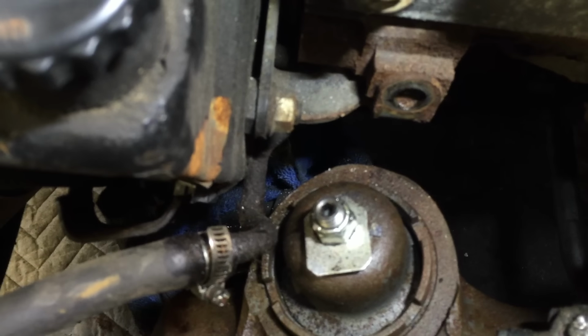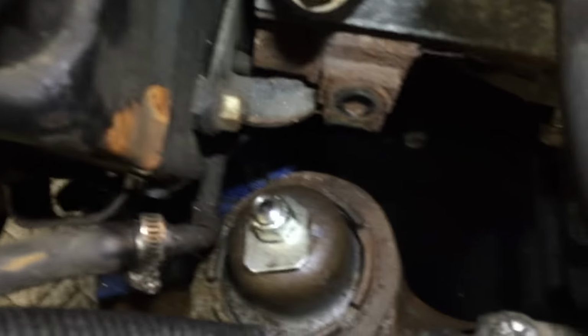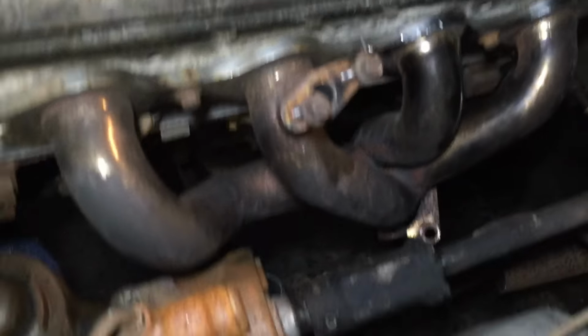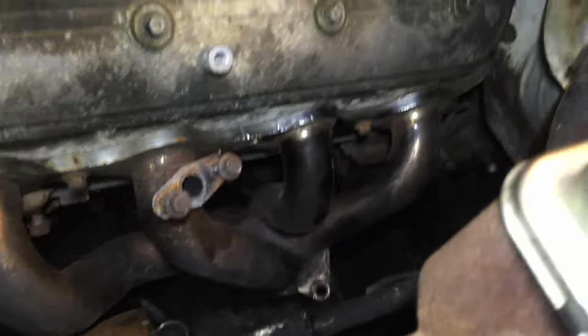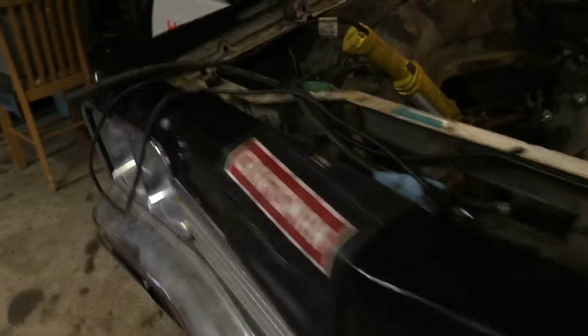And the other big concern was down here, I just had to bend the return line slightly, but the power steering fits around the steering box. This is a big thing with my G-body wagon. Would be annoying to fit that guy. And then someone had given me shorty headers. I have a bunch of different manifolds, but I think it'll be funny. These shorty headers drop literally right in, and they look like they're going to clear the torsion bar no problem, but we're going to weld V-bands on the ends of them anyway to attach to the exhaust.